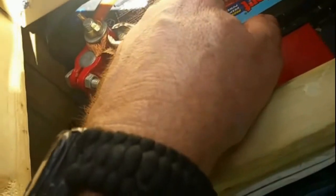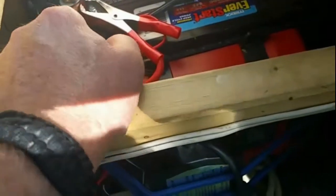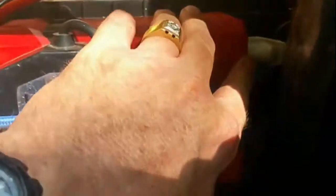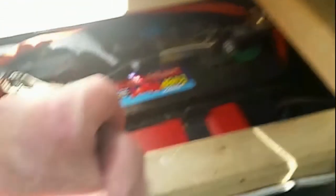Down here for my electrical system: first I have my marine battery, wired up to the battery isolator so it's always charging when the engine is on. Second, I have a 750-watt 12-volt to 110-volt inverter. It's got its own built-in fuse system, so the 110-volt lines running out of it are already fused. It's connected directly to the battery with alligator clips.